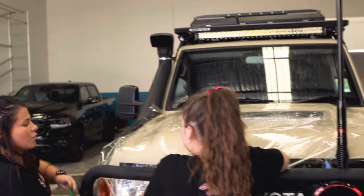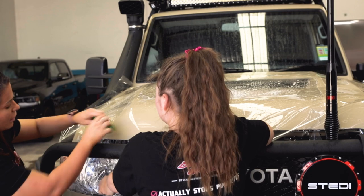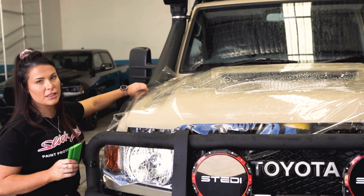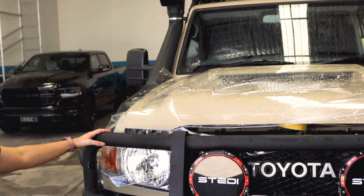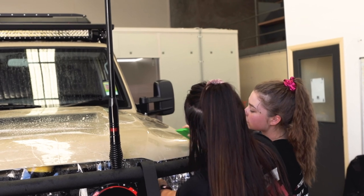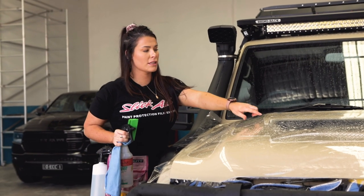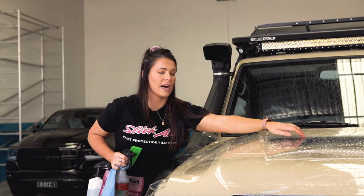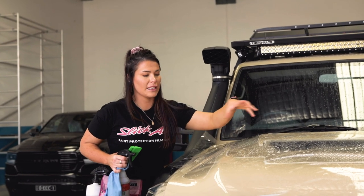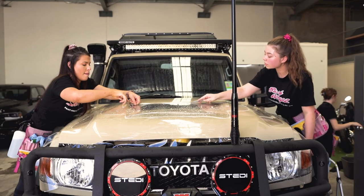Glass out that corner — there really shouldn't be any fingers around this front section, only very tiny ones, and I'll correct them if it does bounce back. You can see now this valley is looking a lot more manageable and there won't be fingers when I come to cut this out. Keep plenty of slip in the center of the bonnet and then alcohol right here, trying to correct those fingers. Once we've done that and I'm happy with how it looks, we squeegee down here and cut out the scoop. The scoop often changes the way the film is sitting because there's a lot of tension in this area, so once we relieve that the film will finger up a little — that's why I've left the bottom loose down the center so we can readjust it.